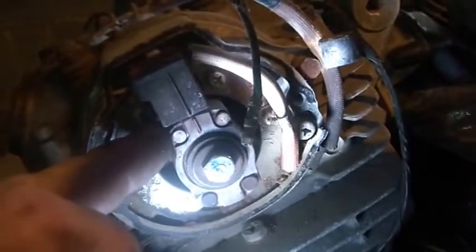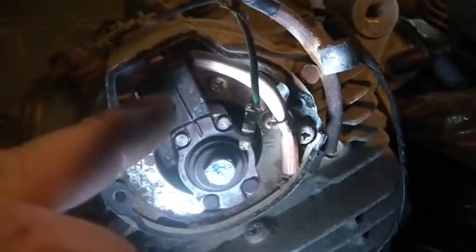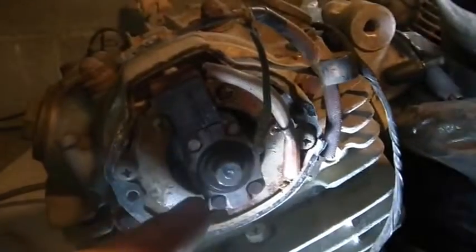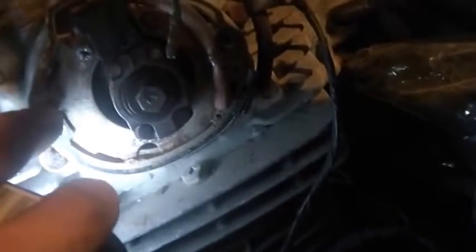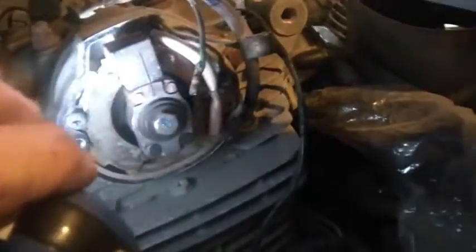To fire, you need the magnet up and the CDI and the advance to be perfectly lined up. Also make sure you have a spring on there that's actually working — if you do the advance and it doesn't return to place, that's going to cause trouble. The CDI moves; you've got a couple of screws you can loosen to move it around and make everything right. Move the CDI to where you have the F mark.